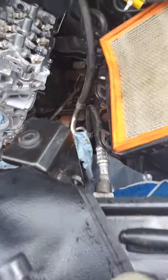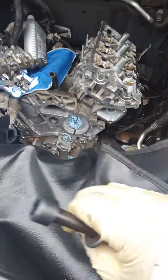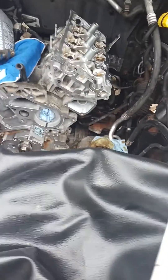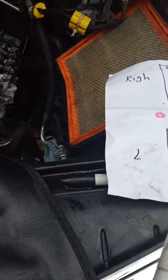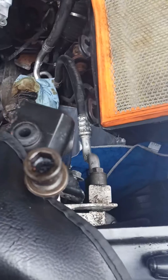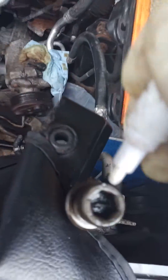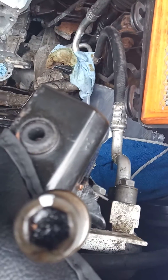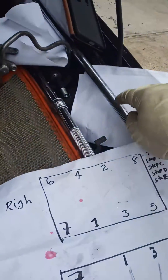After your cylinder head bolts are at 29 foot-pounds, here's what you want to do. Let me demonstrate with an old bolt - here's a clean one. After you've torqued to 29 foot-pounds, you put a straight mark right here on the bolt head.